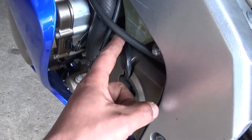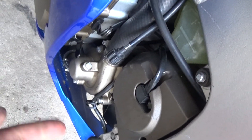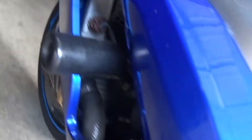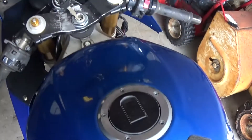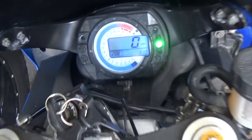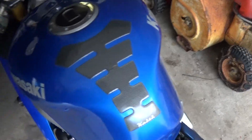I now know why it was losing coolant — this reservoir is actually leaking. I don't know where exactly, but right there a little bit, so I might have to get a new reservoir. I also noticed it has a slight oil leak, probably from the valve cover. But not too shabby — the idle looks pretty good. Not smoking or anything.